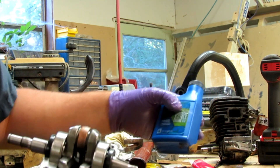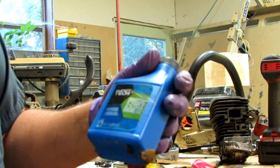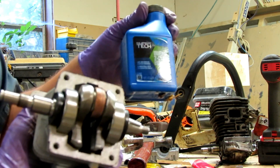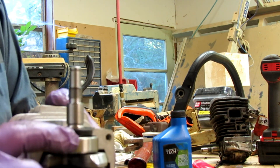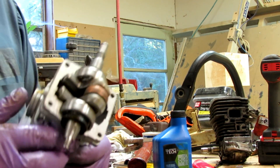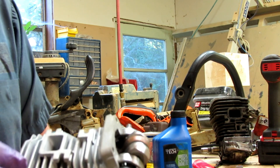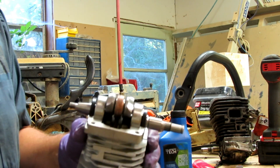The reason I've kind of got it apart here — I don't use this Supertech oil for my gas, it's something that was left here when I moved in — but I'm going to use this to pre-lubricate the engine with some extra oil. I'm going to put it around these bearings here, put some on the crank down here, maybe put some around the rings, and maybe put a little drop in the top where the spark plug goes, just to help lubricate it and keep it from having a dry start when I start it up at first.